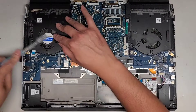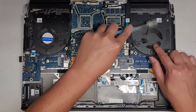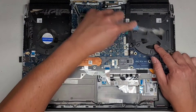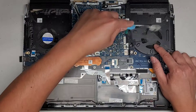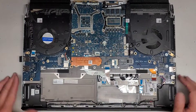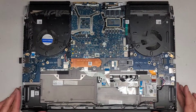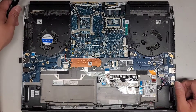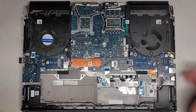We're going to brush the fans a little bit just to loosen up some of this dust — it seems to be stuck pretty strong. We're going to have to take the fans out completely and then clean the heat sink. If the dust is stuck this strong to the fan propellers, then definitely the heat sink is going to be caked on with gunk, and that's what causes this kind of thing to overheat. They said it would randomly lock up and the sound would get stuck and make a loud noise — usually that's when it gets stuck on some sound bite and replays that sound over and over.